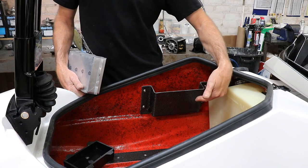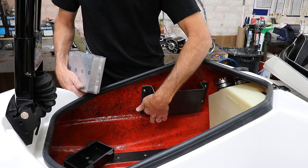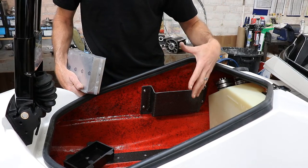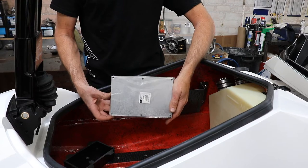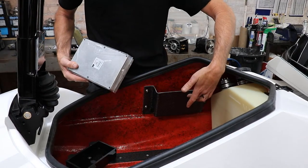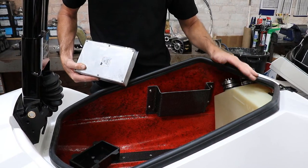Here's a look at our electrical box mount. The assembly includes the cover, brackets fiberglassed in, and the hardware. This mount is intended to consolidate all the two-stroke coils and CDI into an accessory box, available from Pro Watercraft. It's an option to reduce the size of your electrical setup, move it back toward the rider, and keep the center of gravity where you need it.